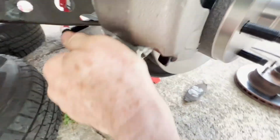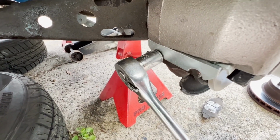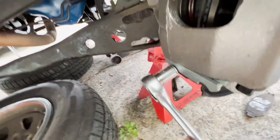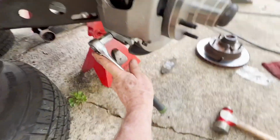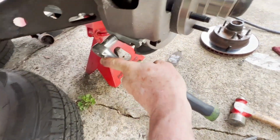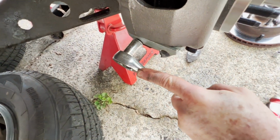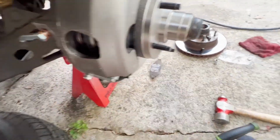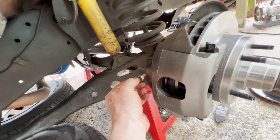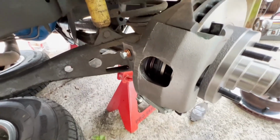Kind of right. Just go easy. I'm sure there's a torque spec for this, but use common sense and feel. Don't use a half inch drive on this with a super long handle. I don't know if you're able to see it, but I was kind of holding it like there, so I wasn't all the way back on it. And it'll just stop at the right place. So yeah, doesn't need any more than that. I'm probably going to need both hands to bring the line back down. I want to clean the end of that anyhow. But again, one washer inboard, one washer outboard. So I'm going to set the camera down and do that.